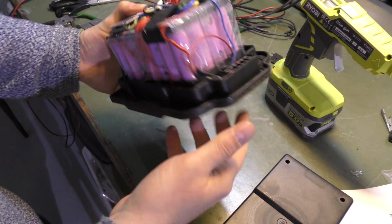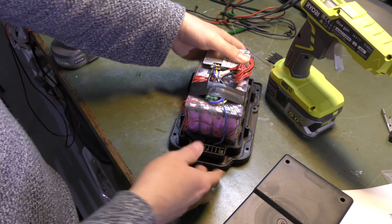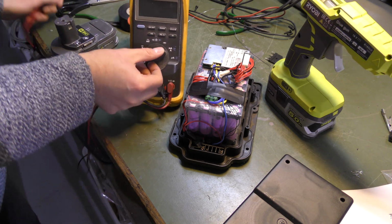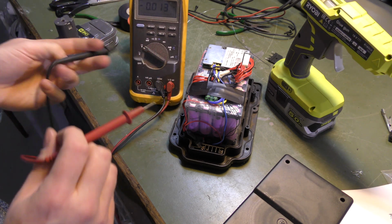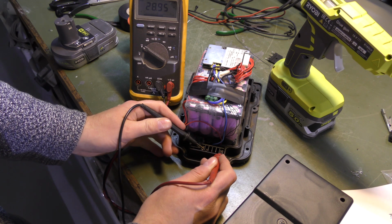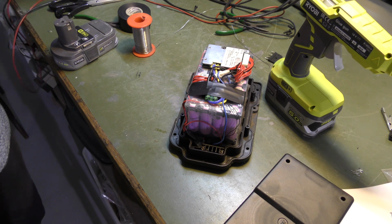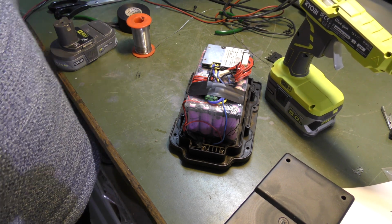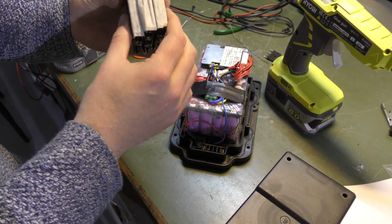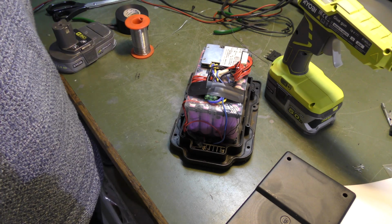It looks rather awesome. We didn't really measure the voltage on this too. No, I did. I didn't show you, so we better do that. Multimeter here. Dust off the display. Power. Voltage. And we see 28.95 volts. Awesome. We did also see a good voltage on the other battery, the one that I have to exchange. By the way, these cells that were blowing up have kind of returned to normal. Not that that changes everything, because I don't trust them when they do that.